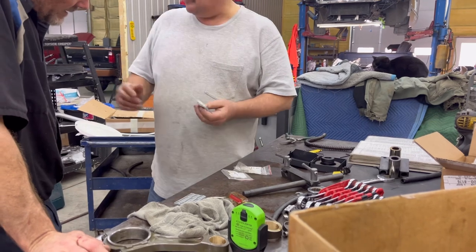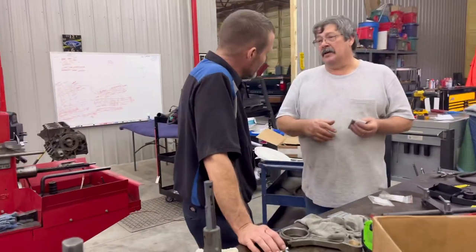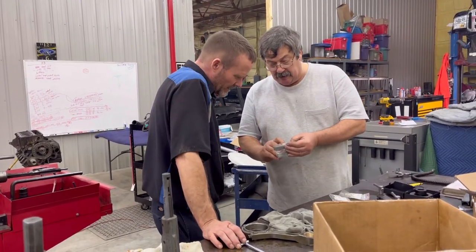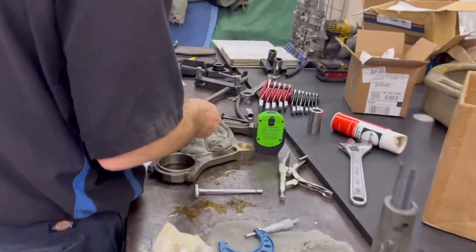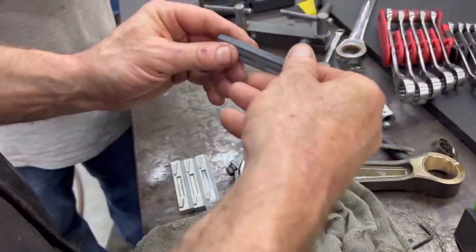I don't think a fine stone on brass is the way to go. They make fine, but I don't think it's the way. It loads up. And you can just look at the grit on this. What's in there right now is a J25, which is a roughing stone, right? The finer one will just fill it with brass. It can load, that's kind of the issue.